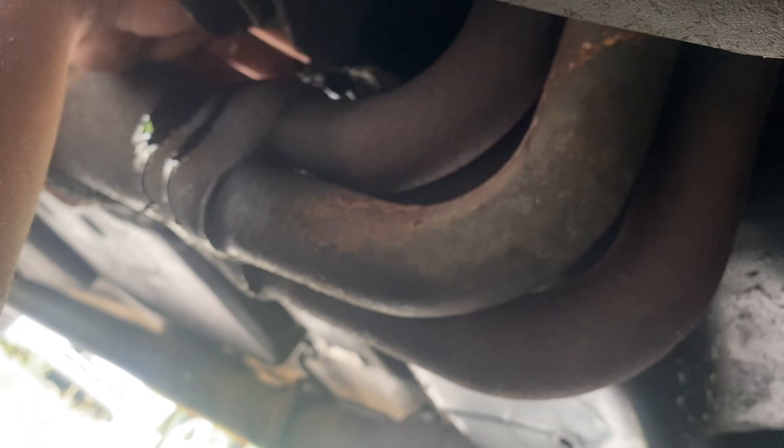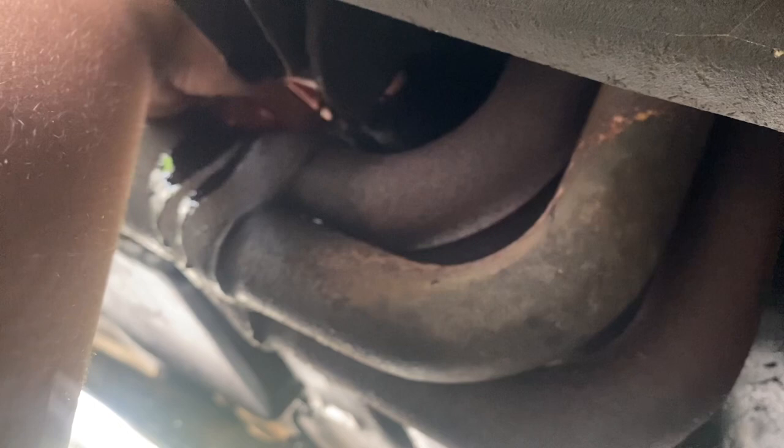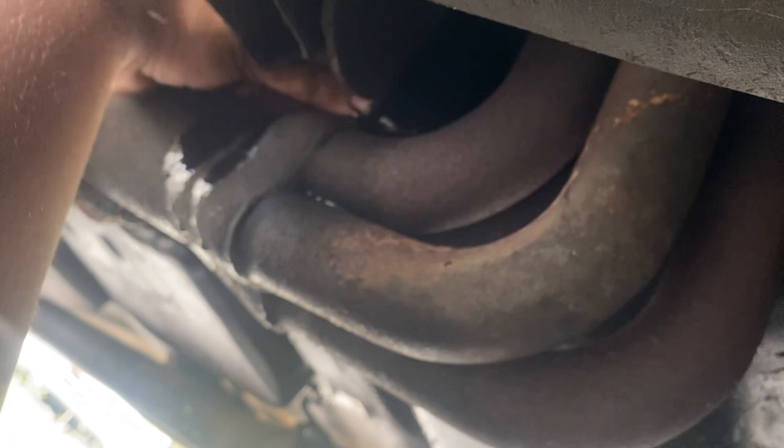Go ahead and spin this filter off here. I'm hoping I got the right filter — like I said, this engine's out of a '72 Delta 88. The Wix filter I got seems like it's a little bit shorter but the diameter should be the same. The oil's hot — I did take it for a little bit of a drive around the neighborhood to try and loosen everything up so I can get all the oil out.